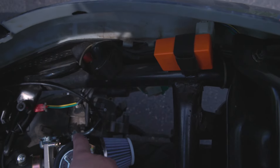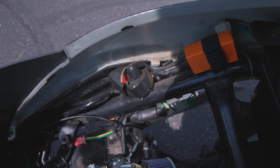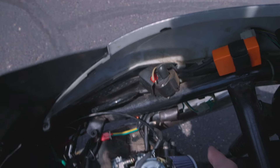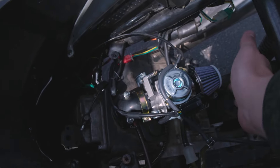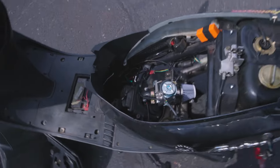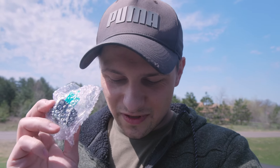The suggestion was getting this plugged in because it was like having to choke on the entire time. Somebody else suggested that the air filter and the intake tube I had was gonna make the engine struggle a little bit — just because it's a little weird. So I put this other one on. I also went and got an NGK spark plug, so that's in there.